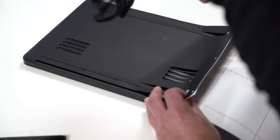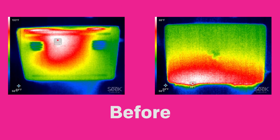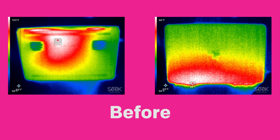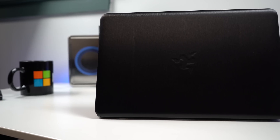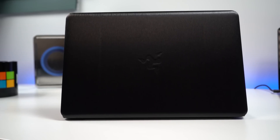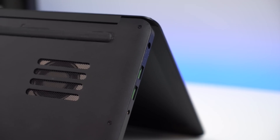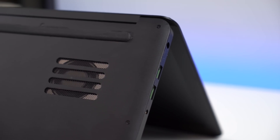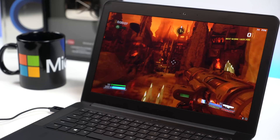As expected, there really is not much difference besides a couple of degrees here and there. There is really no discernible difference between the peak temperatures on the Razer Blade with or without a DBrand or Decal Girl sticker on top. The heat dissipation between the two is not any different either — putting on the sticker does not cause the heat to become more insulated or concentrated in any certain areas. In short, there is really no difference between the two with or without a sticker.